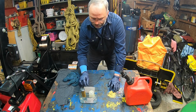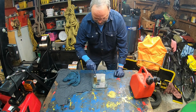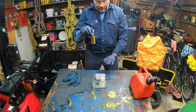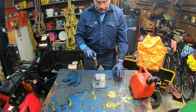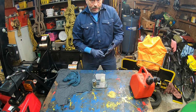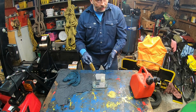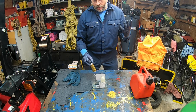All right, folks, so what I've done is I put the fuel filter upward. This is the main entrance right here, and I'm just gonna put it there. So what I do is basically I fill up that bowl. I have two bowls. One is for depositing like this, and then I have a cleaning bowl on the side. I mainly use naphtha. I brush the outside of it, removing the deposit into the naphtha. Why I'm using naphtha? Because naphtha is a cleaner also, and it does evaporate.